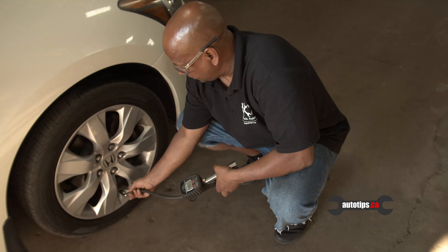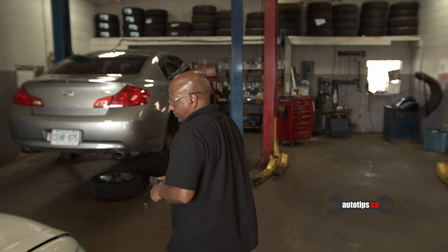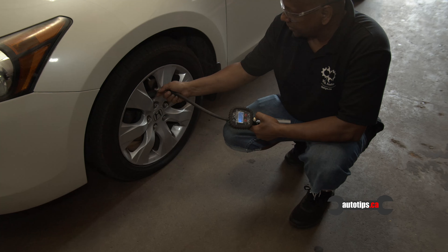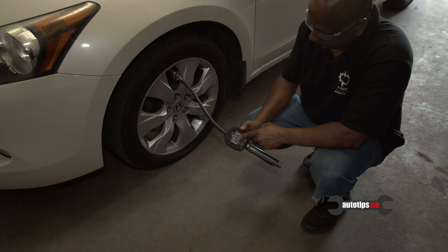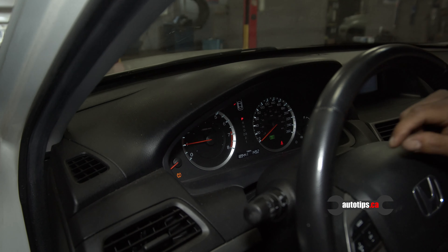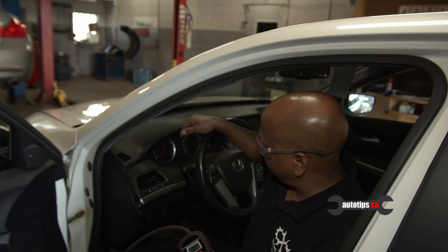So let's check the tire pressure. One tire was reading about 32-33 PSI, which is fine — that didn't trigger the warning. But when we come to the next tire, this one is way low. You can see the tire is pretty flat. The sensor is actually functioning correctly because it's showing us 14 PSI. That's why the light on the dash was on — this is the actual warning light that tells you there's a problem with the tire pressure. We're going to fill up that tire and then take it for a test drive to see if the light goes away.